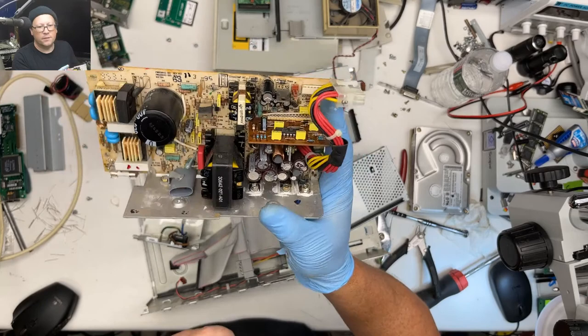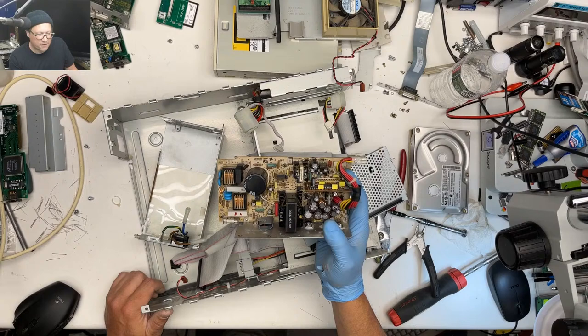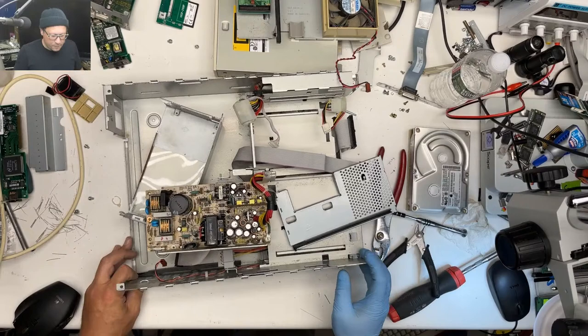I don't know. What did I get my 2SI up to? I think it was 33 megahertz. But I wound up turning it back down because I think the floppy drive stops working at like 27 megahertz or something like that. If you don't use the floppy drive, you can make it go a lot faster.